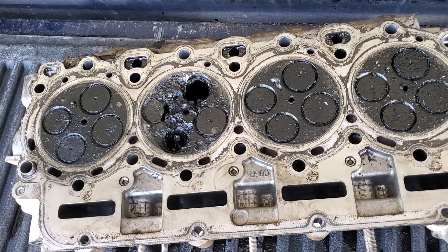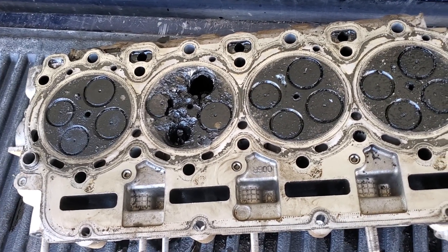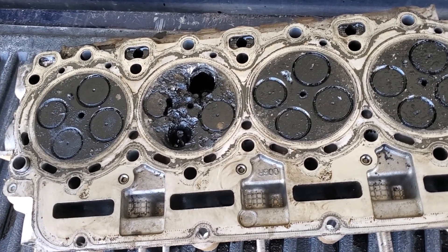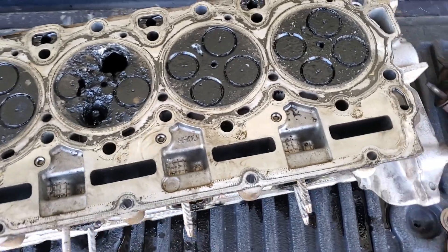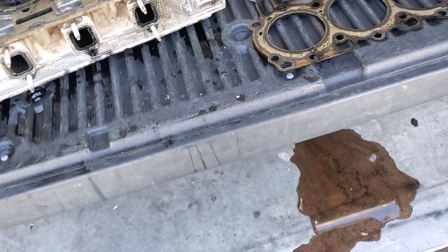Which makes sense why the cylinder balance on the right-hand side was positive 10K and the left-hand side was negative 999. It was sucking all the fuel from cylinder three and feeding it through the intake, so they didn't know what to do.